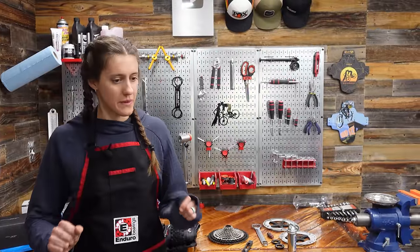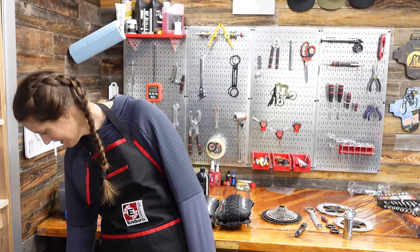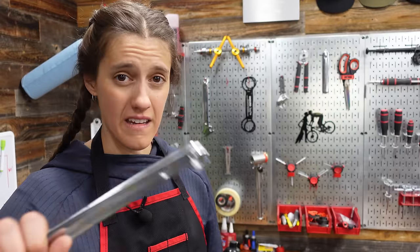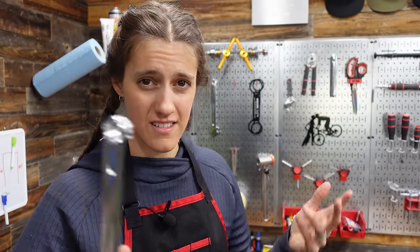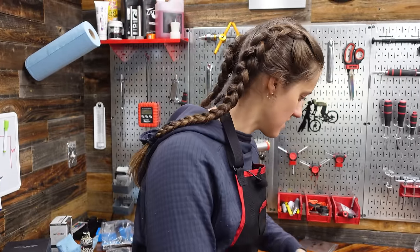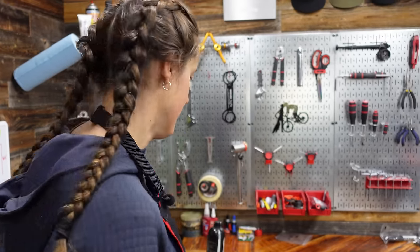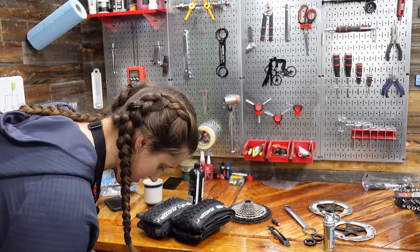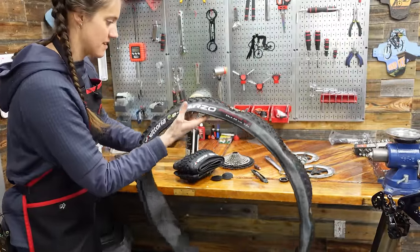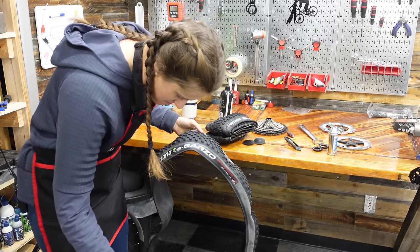The next thing is wheels. For that you'll need the wheels, tires, tire sealant, cassette, brake rotors, lock rings, valve core remover, the cassette/lock ring tool, possibly a tire lever, grease, and an air compressor or pump. Rotor on the left, arrows going forward, cassette side to the right. There's an unspoken rule to line the logo up with the valve stem, but honestly it's gatekeeping garbage — it doesn't make a difference. Get the bead into the center channel for more space, then just lean back and bang — seated.